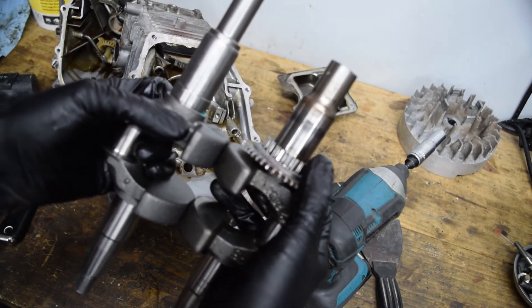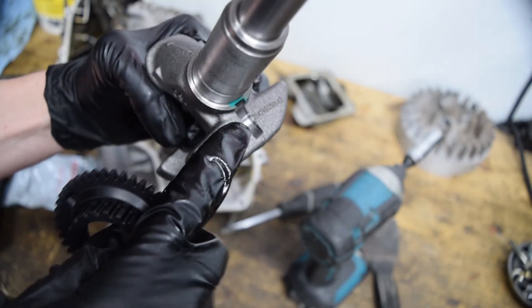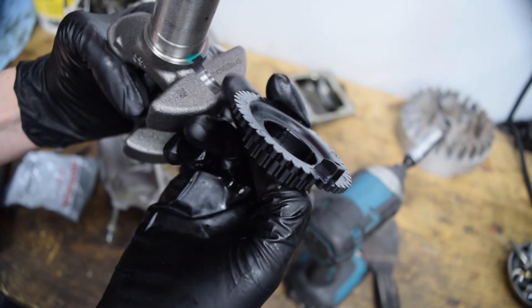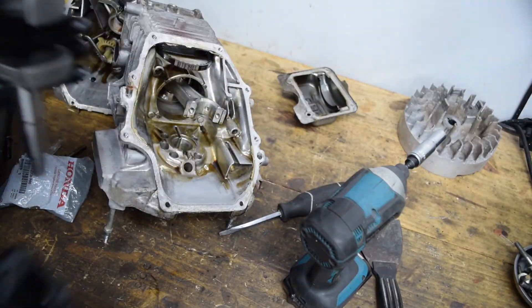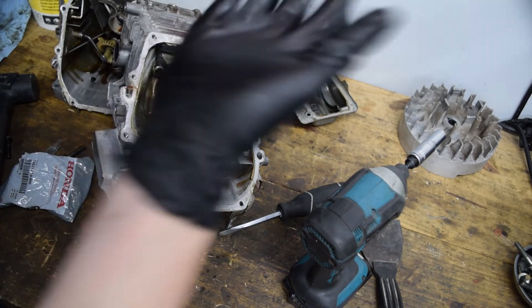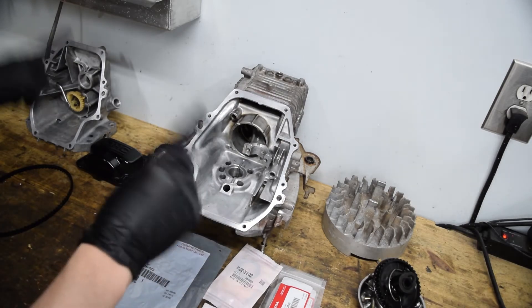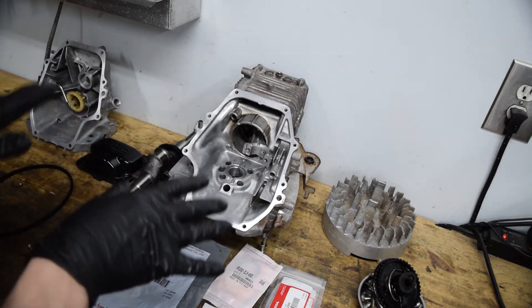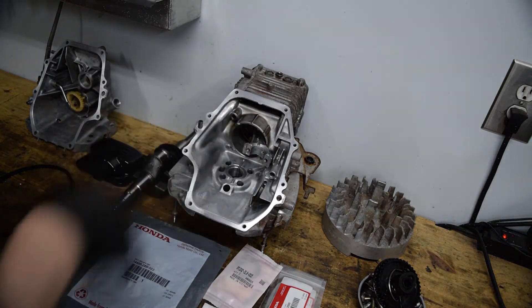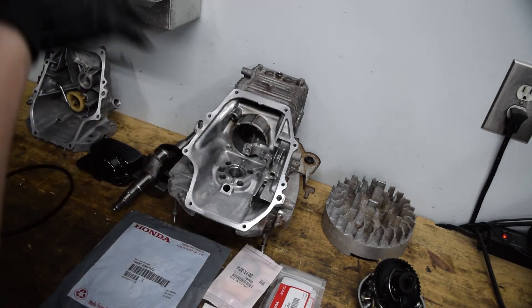I'm not a huge fan of the plastic timing gear, but there's a little notch in the crank that corresponds to the indentation on the timing gear and it just drops on. I could literally throw this in right now and have it done in a couple minutes, however I'm going to order the seals and the timing belt since I'm already here. The order of operation is: replace the seals in the case, get everything mocked up with the belt and crank and connecting rod, use a bunch of assembly lube, then RTV around the case and valve cover.